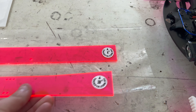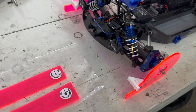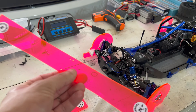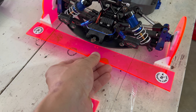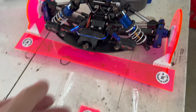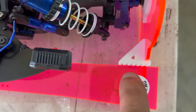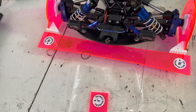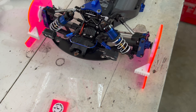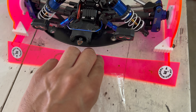And if you flip it around, this will be three degrees. I believe, because my car has already been aligned, I have two degrees. So what you want to do here — take the two degrees, make sure that's facing towards the vehicle and put it right here. Mine is two degrees. See how there's no gap there? And there's no gap on that side. So if I wanted to get three degrees, all I would do is flip it around and put it right here. Make sure it's even on both sides.